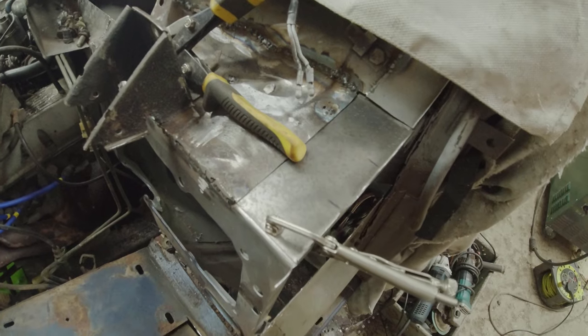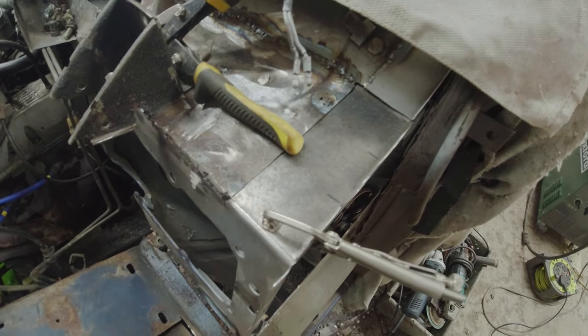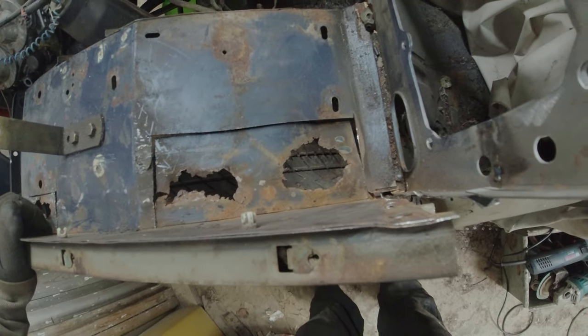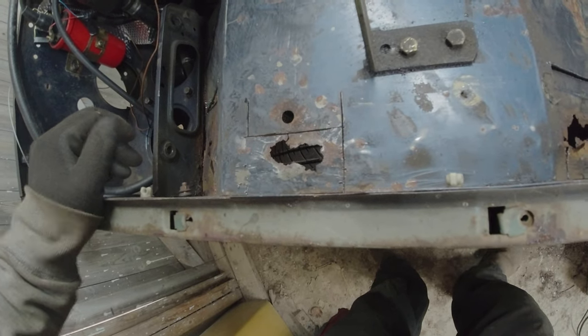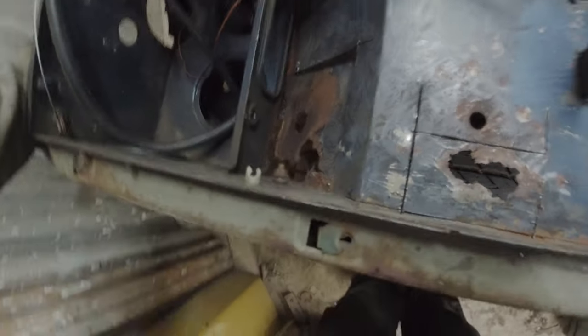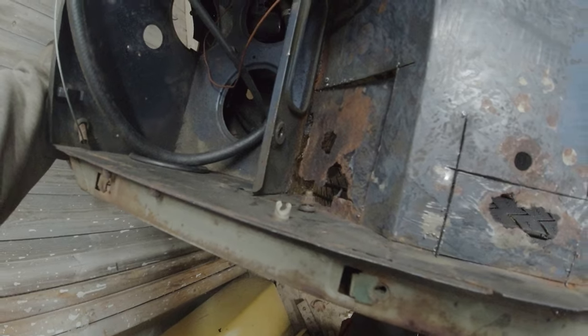How about that? Getting ready to power up the old welder again, welding that bit. Still not got my belts yet. So I thought I'd actually attack these chunks down here. Now, what I do here is I make a cut with an angle grinder and then get the reciprocating saw in there because it's less aggressive on the metal, less aggressive on the sparks flying all over the place. You can see I've got fire blankets, courtesy of Dale, thank you, kicking around, pardon me, all over the place.